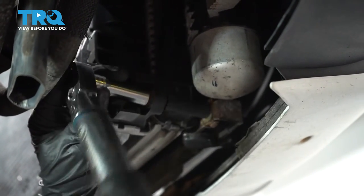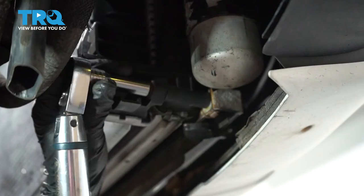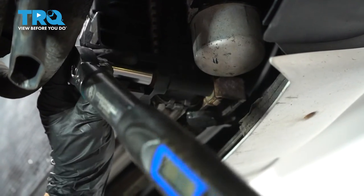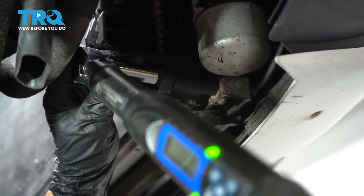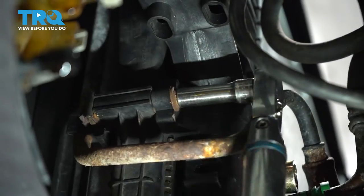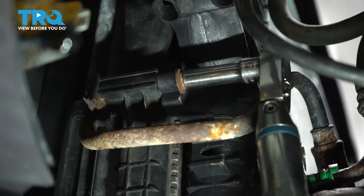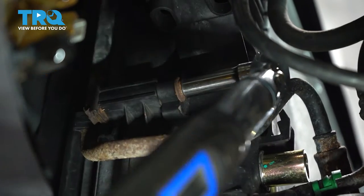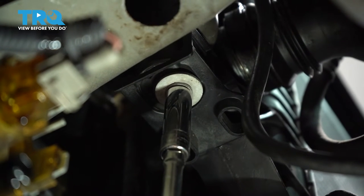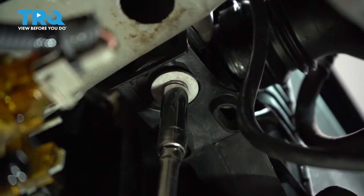Now that I know — I'll bottom it out a little bit sooner. Because there is plastic involved, just tin clips, and these are such thin bolts — smaller than 6 millimeter — you don't want to snap them. It's appropriate to use the recommended torque spec of 88 inch pounds. Torque the driver's side as well. Now we're going to torque the actual mounts — that's a 12-millimeter socket at 25 Newton meters, which is 221 inch pounds. Do the other side.